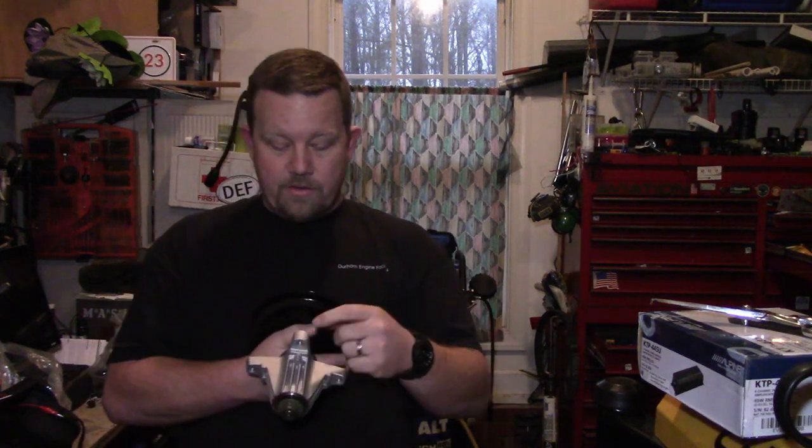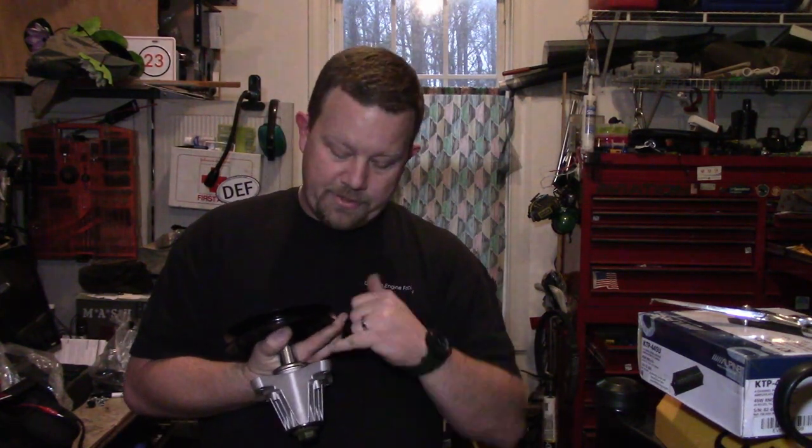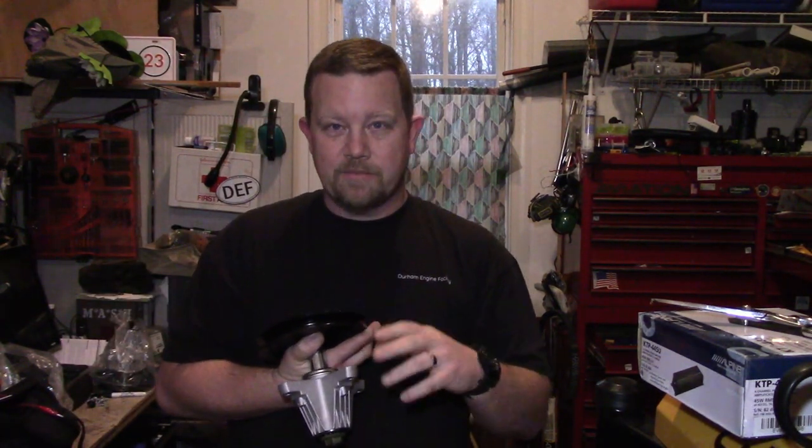Some people want to use Loctite — that's your call — but personally I don't, because I want to be able to pull that spindle back out. We know this is aluminum and the bolts are steel, two dissimilar metals. Over time the aluminum will corrode around the bolt and it'll be a hell of a time getting it out. If you tighten it securely enough the bolt usually comes out fine; if not, use PB Blaster, Mouse Milk, or Kroil, spray it where the bolt penetrates, wait 30-40 minutes, and you can put a little heat on it to help.